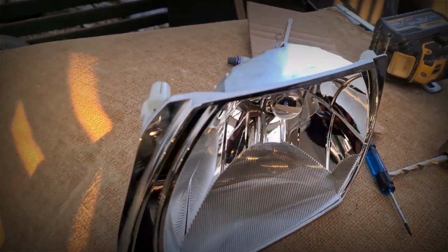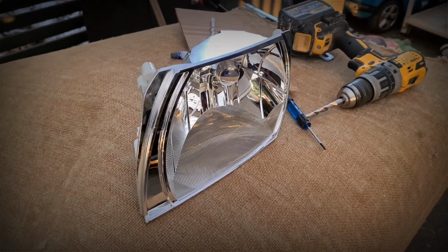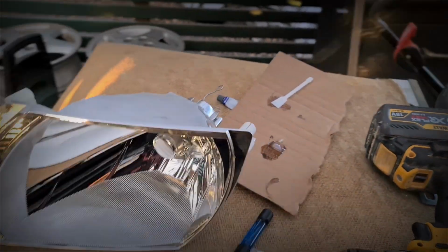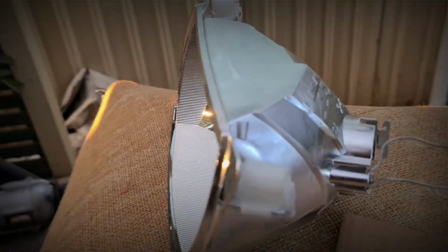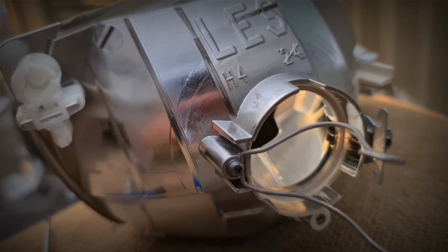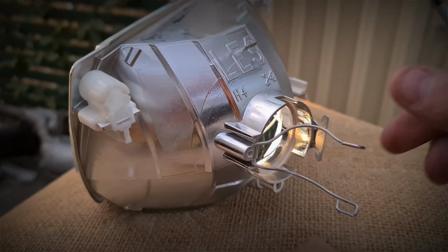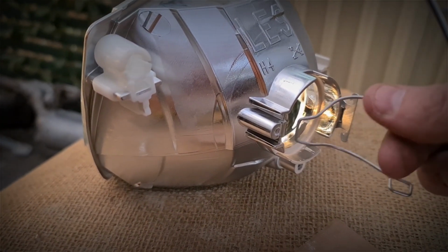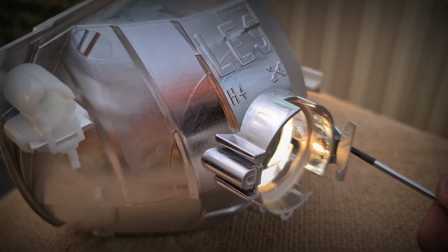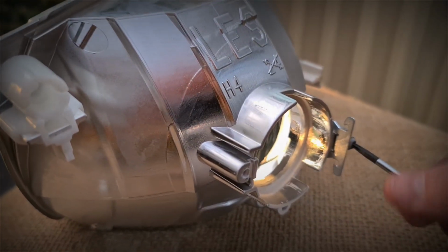Alright, so unfortunately as I pulled the headlight bowl out of the headlight assembly, I snapped that one, so that's currently gluing up and drying. Basically, come around the back here, excuse the dog, I've just got to pull out those Torx T9 screws just out of here. So once you've got that one out, the screw popped out, that simply comes out like that. Mate, don't forget to do the other side here. Get the retaining clip down.